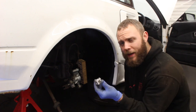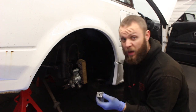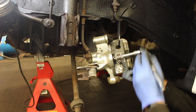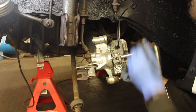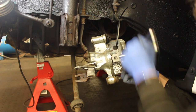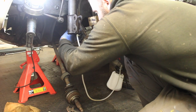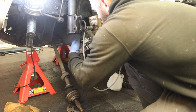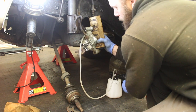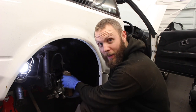If you do pop the piston out and you're as silly as I was, grab yourself this very cheap and effective little tool — a multi-tool with a 3/8 drive on the end that fits all the calipers I've ever worked on. If you've got a wind-back caliper like this one, you've got to wind the piston back in. Pop it on the right adapter, stick it in the two little grooves in the piston on a ratchet, and you can wind it back in. Sorted. Now with the bit of wood in there.